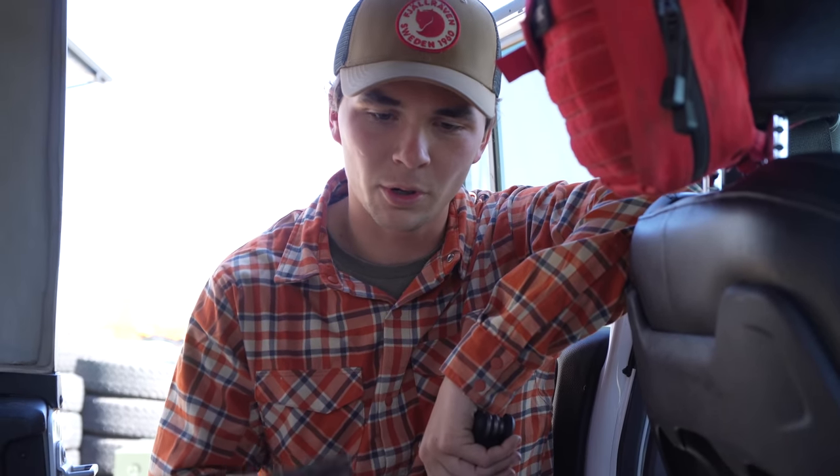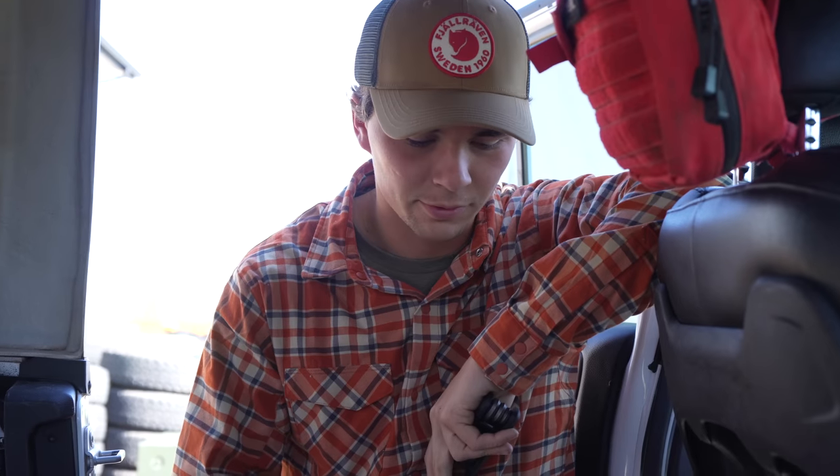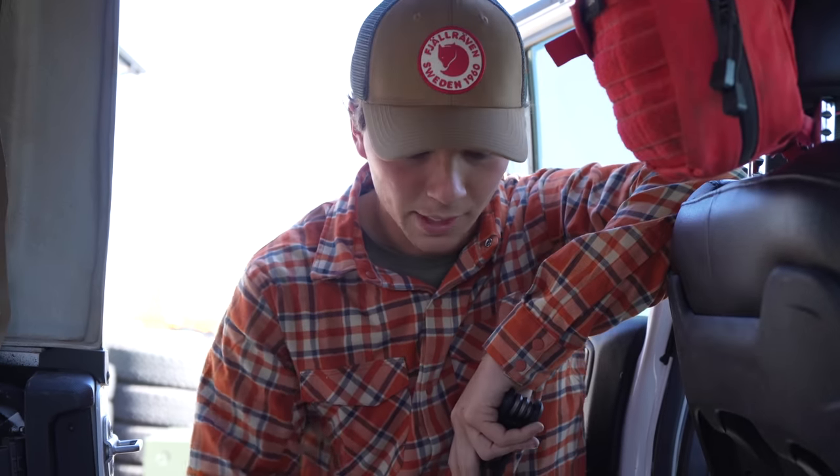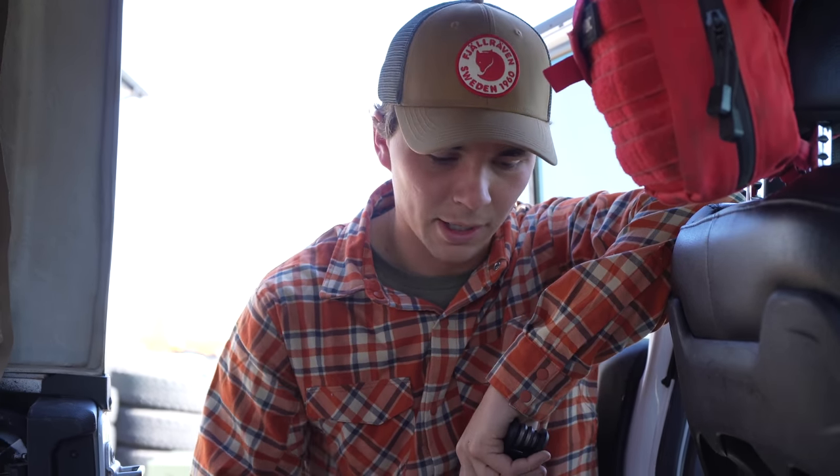So when we got the RedArc and RedVision installed in here, we were at Matt's shop in Oklahoma, Exploration Outfitters, and the mechanics there made these little L brackets of aluminum, and they sized it up for a 100 amp hour battery, which is what we had before, but now we have four 75 amp hours from Battleborn batteries. So we're using their original layout, but making it different so that two 75 amp hours can sit in there and not just one 100 amp.